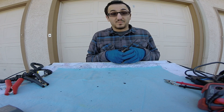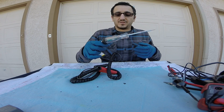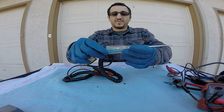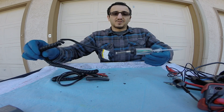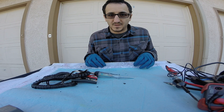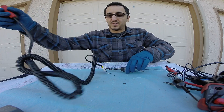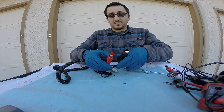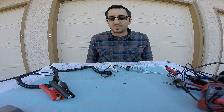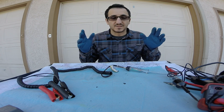The better version of this tool — at a whopping $10 — is your two-probe test light. This has a different style circuit with a light bulb that has two different colors. When you're touching a wire with power, it illuminates red. When you're touching a wire with ground, it illuminates green. What this does is remove any doubt for anyone who doesn't understand the single-probe system, because all you do is connect it to the positive and negative cable of the battery and probe wherever you like. You don't have to reverse anything or think about doing the opposite.